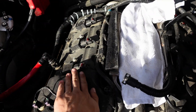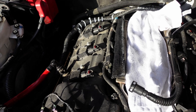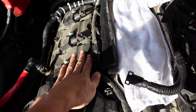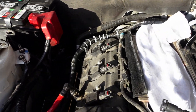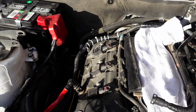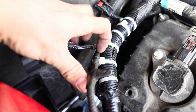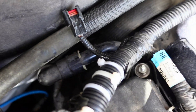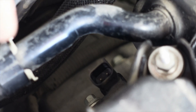For those curious why I removed the intake manifold: I needed to access the wires right below it — there was absolutely no way to clip those with that big thing sitting on top. We have to remove and replicate connections on both sides, and there are wires in the back of the harness to tackle as well. The cam sensor connectors in the back were a real pain to get to — not the O2 sensor since I've done that so many times, but those back sensors had a clip right on top of the harness.